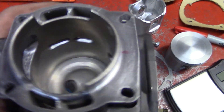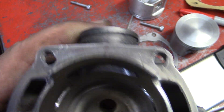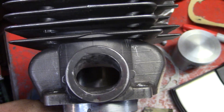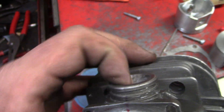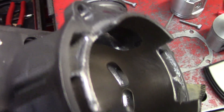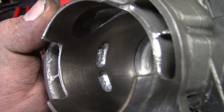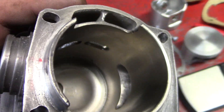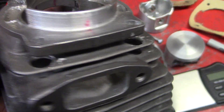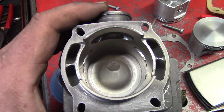Okay, here's the cylinder. That's the intake all filled in with JB Weld. I had to raise that roof up a good bit. My cases aren't quite all the way done - I have so much time to work on this stuff. Transfers, I got them raised up a little bit, they're about 126, 127. Intake, I got it set to about 79. Exhaust, I got it to about 100. I'm not going to get too crazy with polishing it - I want to see what this thing does.